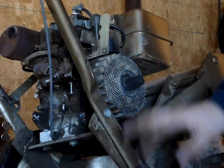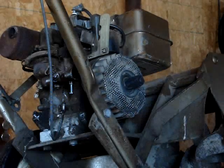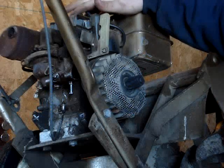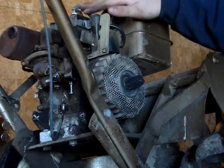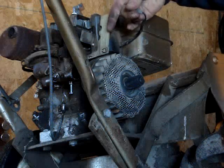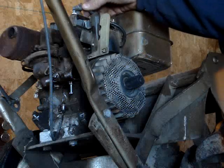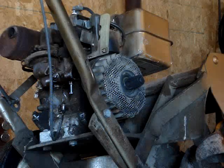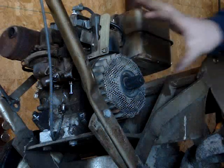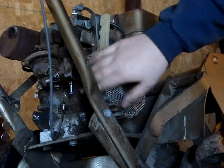I've got the wheel off here and the big cover with the pull start off. The problem I'm having is I ain't got spark — not enough that it'll jump a spark plug. If I take the wire and hold my hand on it, then touch a ground and pull it over, there's a little bit of a spark there but not enough to work and jump the gap in a spark plug. Here's where your coil is, and then there's magnets in the flywheel.